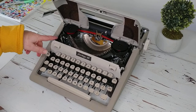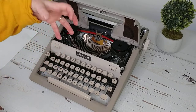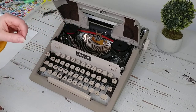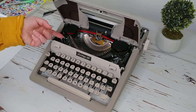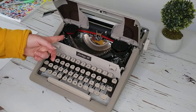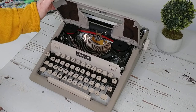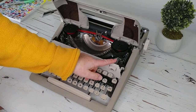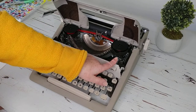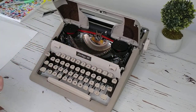When you get to the end of your spool the ink is going to get really light on your paper, or sometimes the typewriter will feel like it's jamming up. Before you panic, just open up the hood and reverse the direction right here — it's a very minor thing that you do, and oftentimes reversing the direction of your ribbon spool solves a lot of problems. Also, your color selector is right here on the right side. It's on red right now — just press it and it's on black — and back and forth is how you do that.